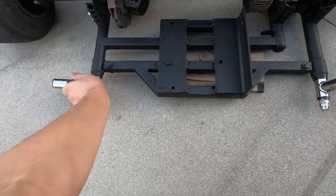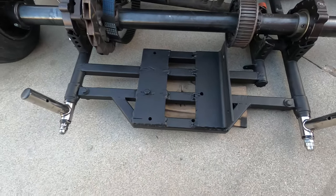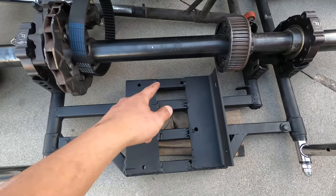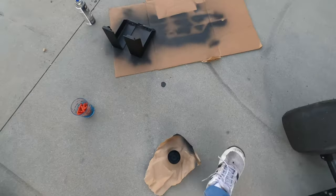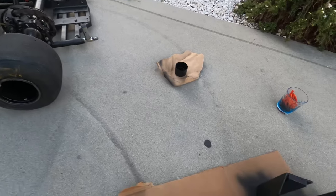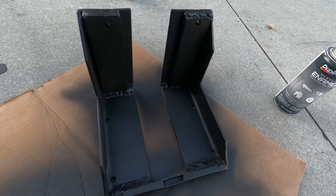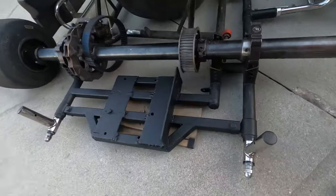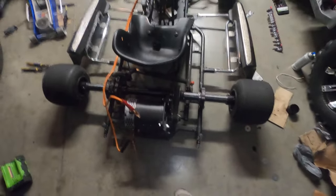So basically what I've done so far: I finished the whole motor mount here, or the floor mount. I think it'll be strong because it has a double going here, one back there, and I think this is going to have enough support. Here is the motor mount — that's the motor floor mount, and this is the motor mount. The motor is going to be aligned here and screwed in here. There's holes over here and I've got a bunch of bolts. This is a 30mm belt but I ordered a 35, so it's going to fit pretty much the whole thing. I hooked it up to a speed controller, a battery, and a throttle — just keep in mind this is all just a test to see if everything runs; this is not going to be my final setup.